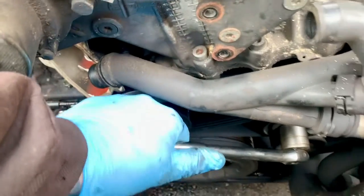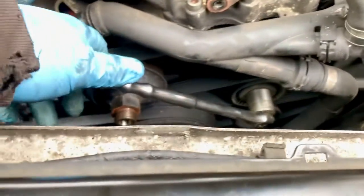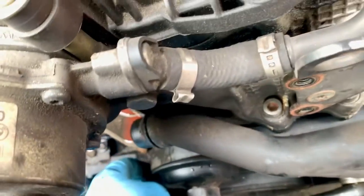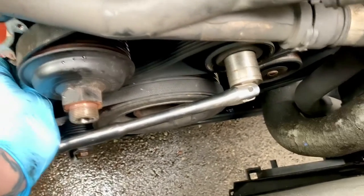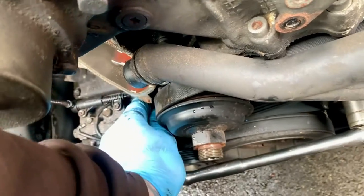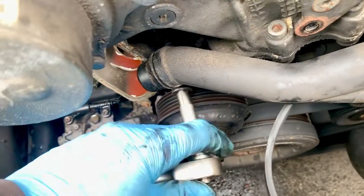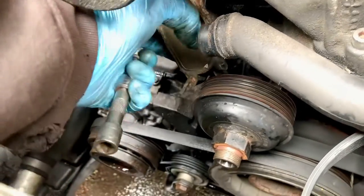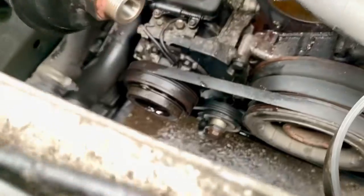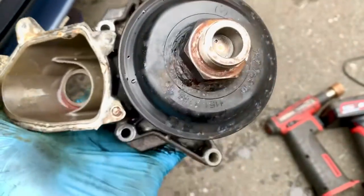So now it seems I'm going to have to take the water pump off to get a drill to it. Make a note of where the belt goes - maybe drill it before you take it off. I'm not going to take it all the way off. There is a tensioner there which when you push on it slackens the belt, and then I can lift the belt off. Now I can remove the water pump which is held on by about 5 T40 bolts all the way around it - well I thought there were 5 but I've only taken 4 out and it seems to be loose. 4 bolts, and that's where they're located on the water pump.